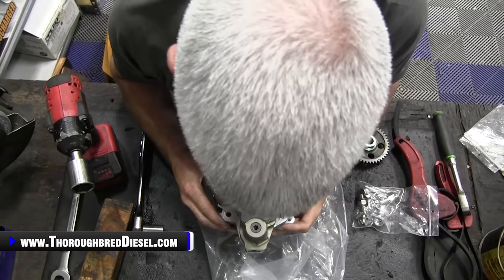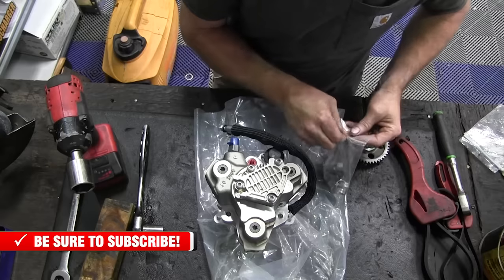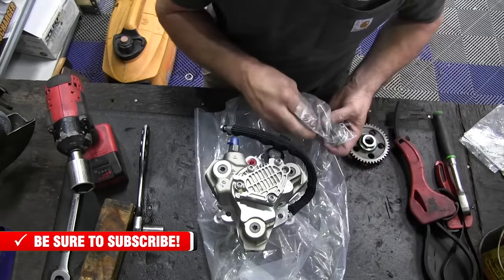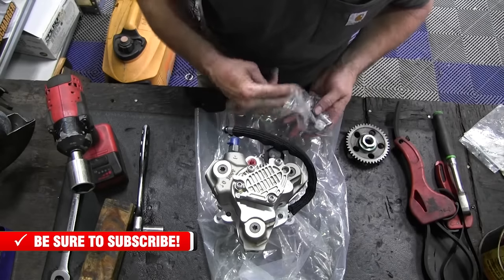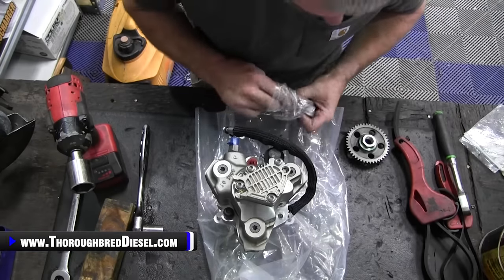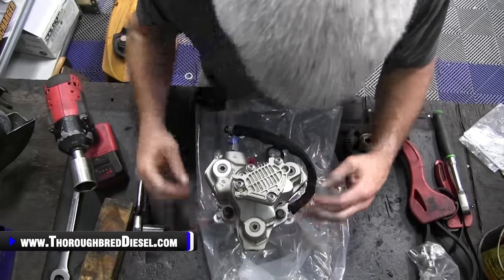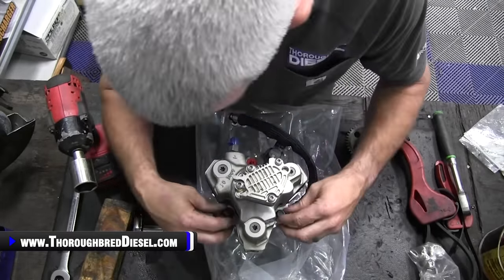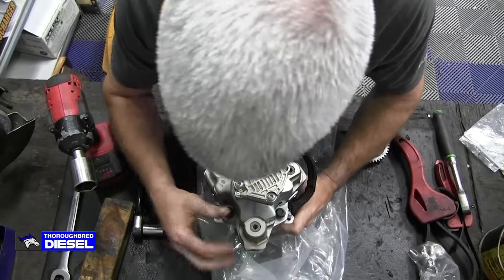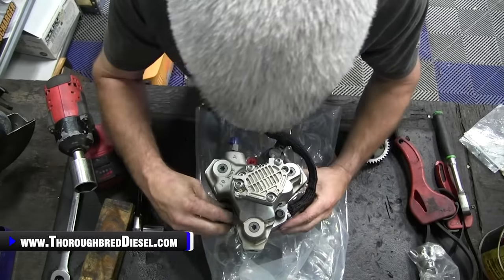What we're doing is lining up the plate here to put our bolts on. And in your hardware bag that Fleece provides for you, there are 3 bolts in there. You'll want to tighten those up to 15 foot-pounds. We'll drop all 3 of them in. One goes right here at the top, and then the other points of the triangle here. And the whole time you're working on this, you really want to be conscious of what's going on with this doser line. Don't bend it, don't cut it off, don't loosen it up, all those things. Just watch what's going on, and you should be fine.